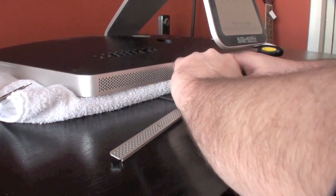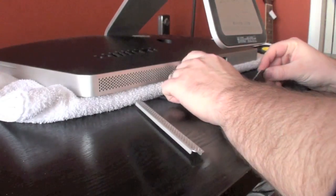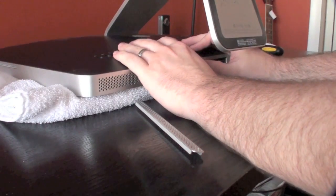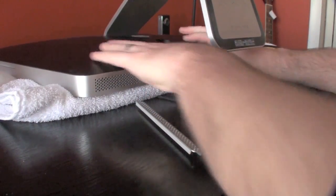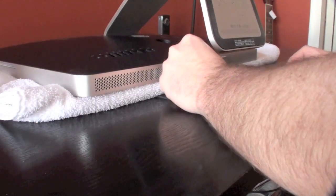If you want to, you can even install another RAM card on the other side. I put two gigs on each side. Most slots will be empty because your Mac probably came with one gig, and that's why you're upgrading — so the other slot's empty. Just put in the new RAM card and flip back up the black tab. Once the RAM is in and the black tabs are flipped in, put back on the plate and you're done.